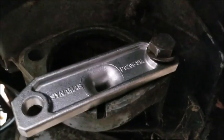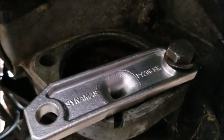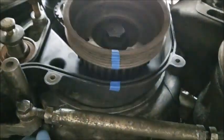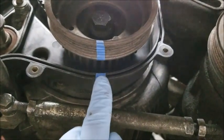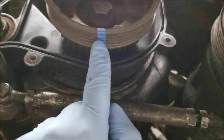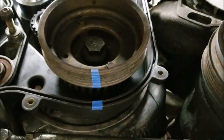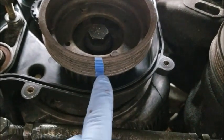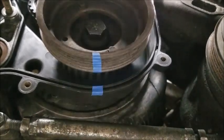I'm taking off the flywheel lock because I need to put the balance shaft belt on, and in order to do that I need to be able to move the crank. I know I'm at top dead center, so I marked the crank with a little piece of tape so I can get it back to top dead center. Some people use paint — I'll just take the tape off when I'm done.